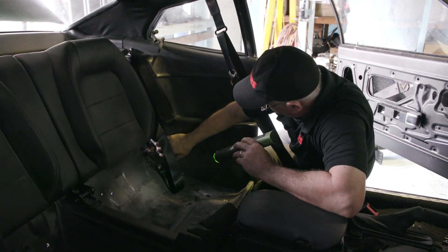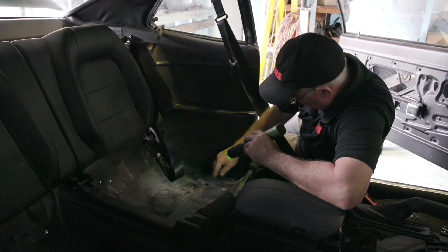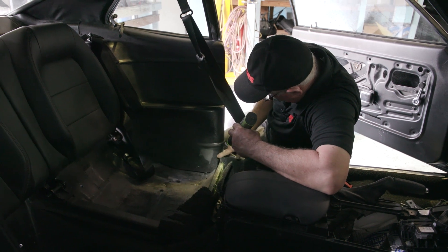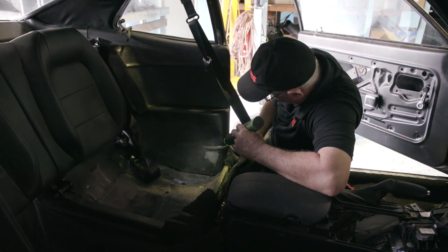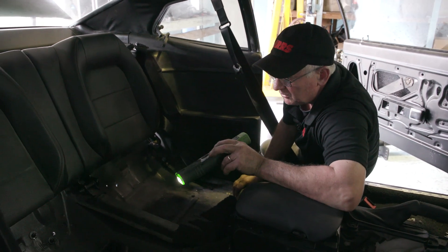Because we've mini-tubbed it, this has come in, so you've got to make sure all your clearance is right for your interior trim. We put a reinforcing rail across from side to side to tie the pillars together, which required some trim work into the original trim. And of course we've replaced all the seat belts with Australian-compliant seat belts.